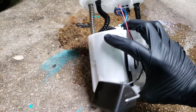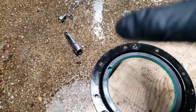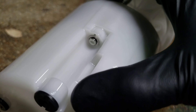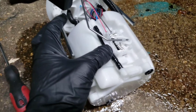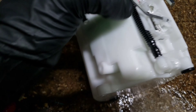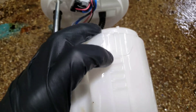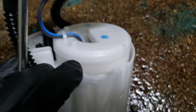So first things first, once you have this out of the car, the whole assembly is just going to lift up after you take all the bolts out. There's going to be a couple of gaskets — make sure you don't lose them or forget the orientation they came out from. There's a spring on one side here where these rods come down. I can see I got gas all over the floor, so that was fun. Here's the spring right there. There's a little C-clip that holds this one from going out. We're going to have to compress this just a little bit, take some pliers, and pull that ring off. Once you have that ring off and you pull the top off, you're going to kind of have to wiggle it around — it'll eventually come off. But there's going to be three clips: one here next to the wires, one over here, and one on this side as well. You can see they all just push up and they'll pop out, and the pump itself will come out.